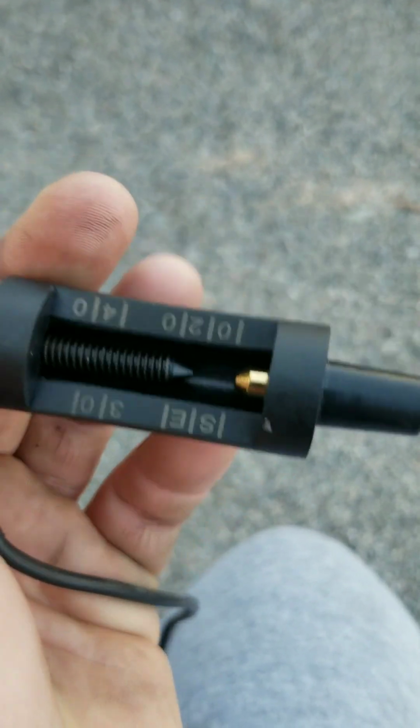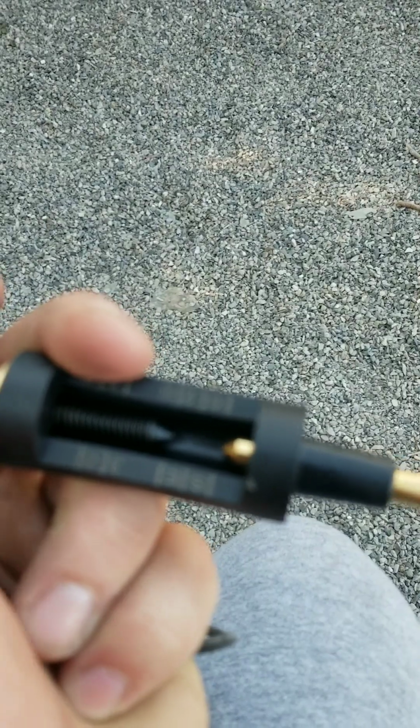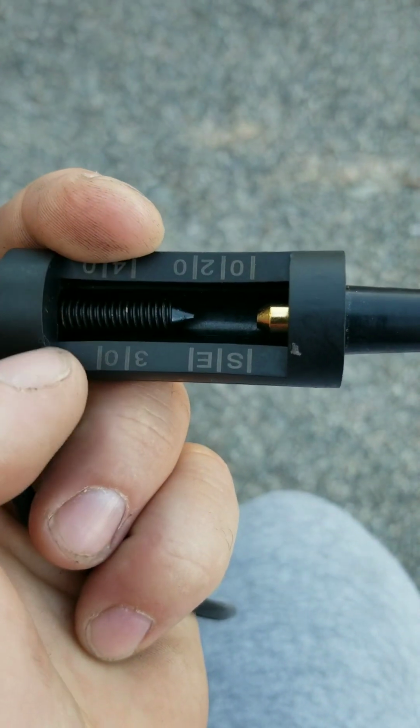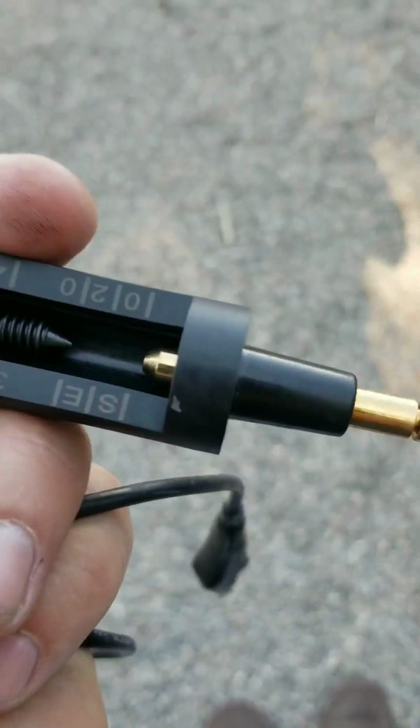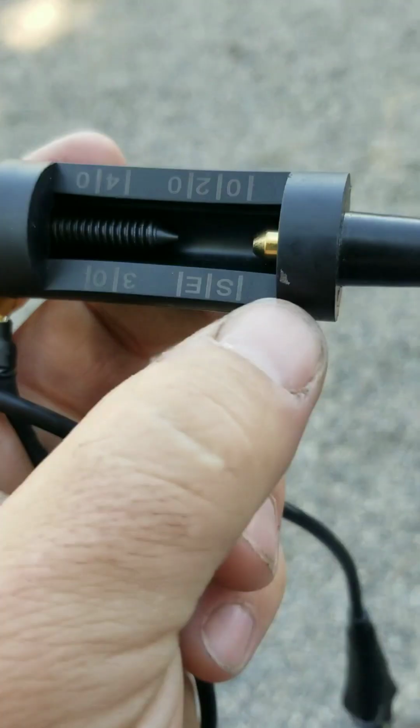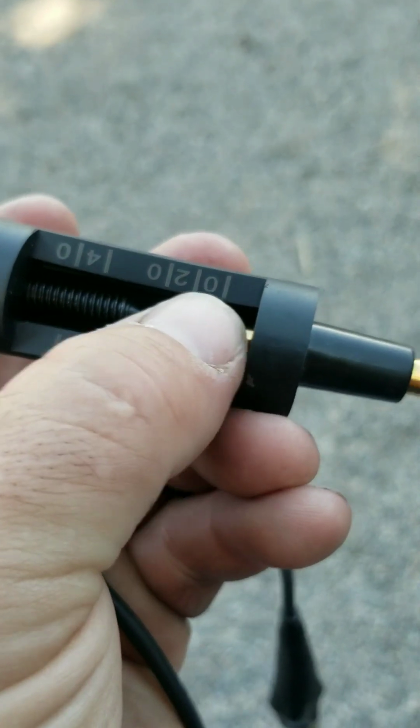So we got this motorhome in, and it had like 20,000 miles on it, and it ran really good, 6.8 V10, and it would spark to about the 2 here. So not a big improvement, but it was an improvement. And the motorhome's 20-something years old, but it ran a lot better than this truck did. So we go get a coil from O'Reilly's. I can't remember the brand, but we put it in, and it's sparking to like the 0 here, so it goes a little bit further. So all these different coils are within this small range here. Had me kind of confused.